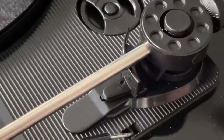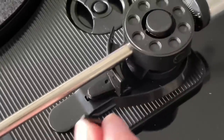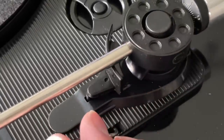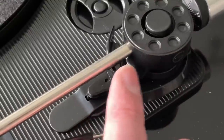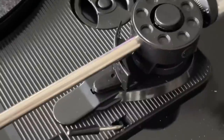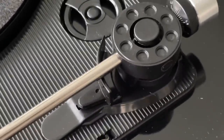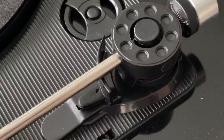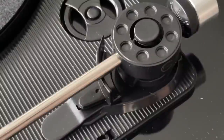We've got a typical lift mechanism with a little shelf right there so you can raise and lower, and there's still some damping fluid in there, which is surprising. It's not even rubber edged on that little shelf — super cheap. When your records skip with these types of mechanisms, just make sure you push down on this little lift shelf thing. That fixes about 80 to 90 percent of those problems.